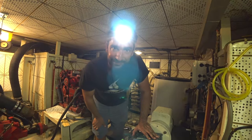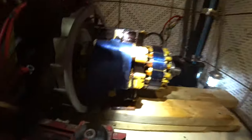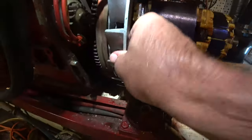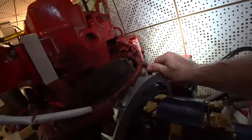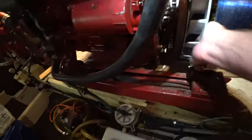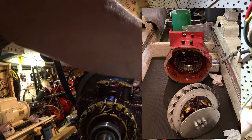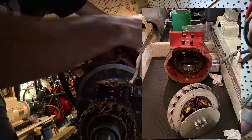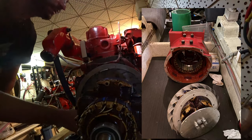What a pain in the ass this is. It's very difficult to get the armature lined up with the holes so you can mount it to the flywheel. I've got it shimmed up here with a little piece just to get it up just right. Getting those first bolts is not an easy task—you've got these wires and crap in the way. And then I've got to get these shims out so that it really meets up well. The reason it's so difficult is that the fan is separate from the mounting plate, so you have to line up the holes from the fan to the mounting plate to the flywheel. Very difficult by yourself—if you had the space for an extra set of hands, it would definitely go easier.